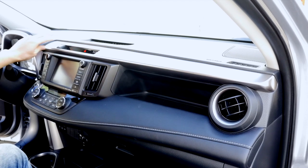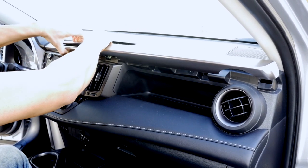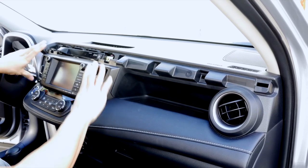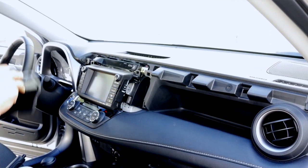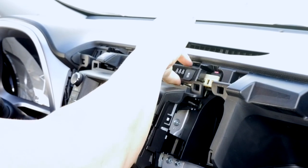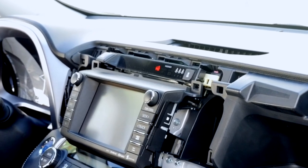The first step is to remove this trim piece up above here. I'm going to start off by grabbing a hold of this trim and just slowly releasing the clips as I go inside. Next step, I'm going to be pulling off these two vents. It's only being held by a clip, so just gently get a hold of it and remove it very carefully by pulling it towards you. Now that those two vents are removed, we're going to remove this piece over here. It has the hazard and also the indicator for your airbags and seat belts.